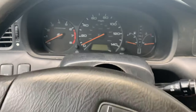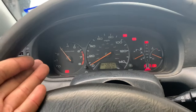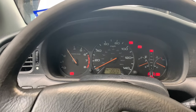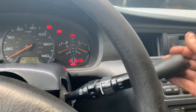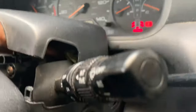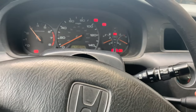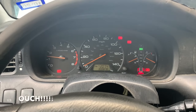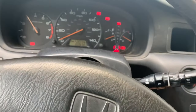Now let's go ahead, put the key in and turn this on. The customer was stating whenever he turned it on — as you can see — high RPM. I was thinking it was going to be the idle control valve, but you're going to see what we have here. The other issue he was having: as you can see, I'm depressing my brake all the way down and it does not want to come out of park. What he would have to do is with one hand press this down. Let's put it into reverse — hear that? Bam, nasty clunk, and still high RPM. Let's put it back into park. Hit the brake — nothing. Now let me show you the problem.